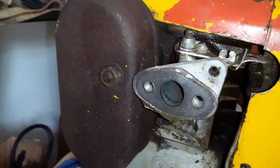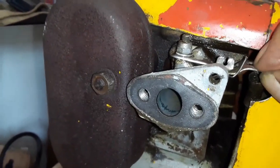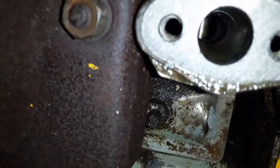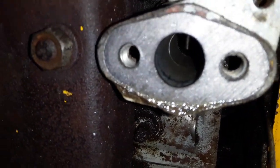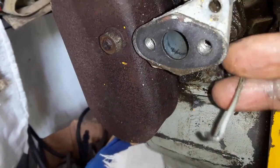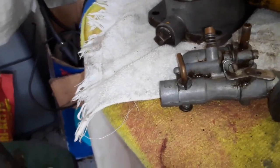Okay guys, just to mention something, I immediately see this top part that I said is a throttle, that is totally not true, because there is nothing on the inside that can move. If I can try to light up inside for you, you look right through to the inside of the engine. There's nothing in this part here. And this bottom one, which operates, this is the throttle. So the throttle sits at the bottom there. Okay, just to make it clear for you, I was wrong.